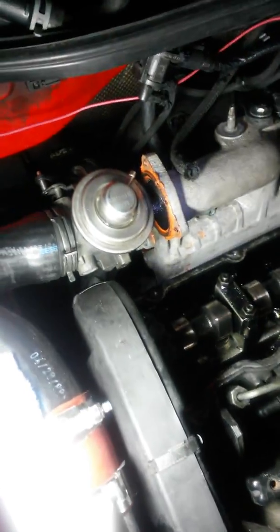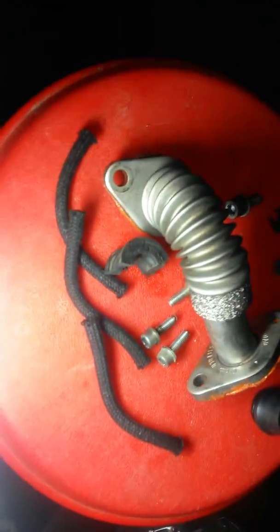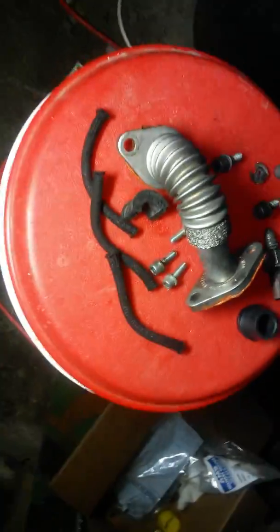So what you have to do is take this return line off first. I'm assuming it's a return or whatever. Exhaust return line, yeah, return side, I believe. Take that off, and then you can get at the last bolt, which is hiding on the back side of the flapper valve, because the other return thing's in the way. So just a little pointer on that.